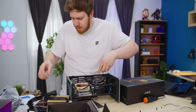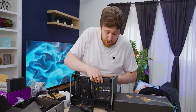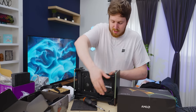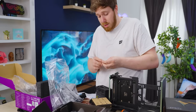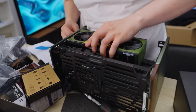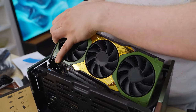We'll get all the cables in and I'll just cry later — that's the plan. I talked about how this can accept some heat from the GPU and exhaust it out, but we're going to orient it the other way because we're not using a flow-through cooler. We're using the 6900 XT, which blows air out the sides. I appreciate that Fractal includes additional power supply screws, because sometimes you lose them and it sucks. We've got the GPU in, it slots in like that — the power connector is on top. This is very clever. We'll get thumb screws in to fasten the GPU in the bracket, then close up the case.